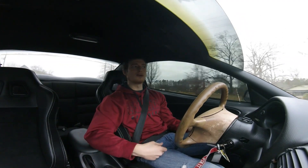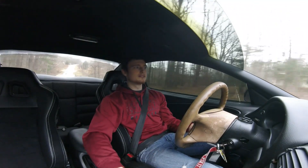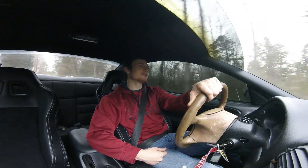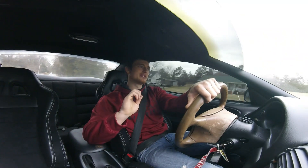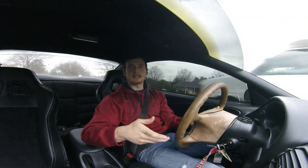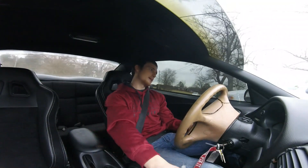The 4.10 should make it a lot better. The car's not the fastest thing in the world but it runs pretty good. I've been in cars that are a lot faster — my dad's got a '73 Chevy truck with about 650 horsepower, and that thing will move. We're trying to get this one a little better. Like I say, I'm going to end up ordering the AFR heads, which should be about perfect for this. I also got another cam — a Lunati cam — that I'm going to be putting in it. As far as the gear goes, it's okay, but I want the 4.10. The 4.10's going to make it a lot better.